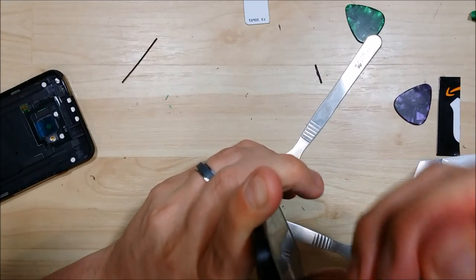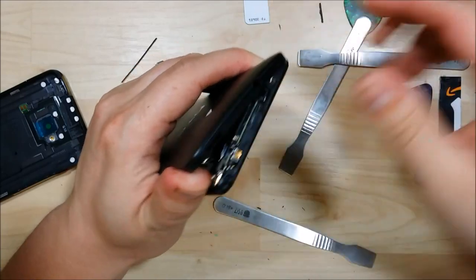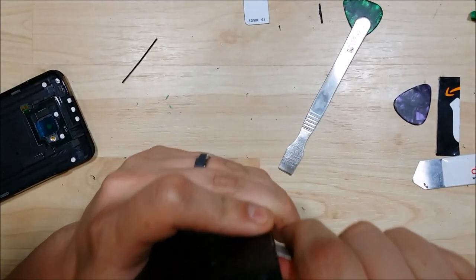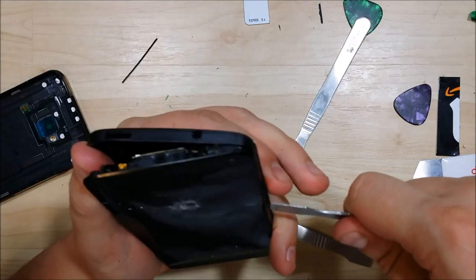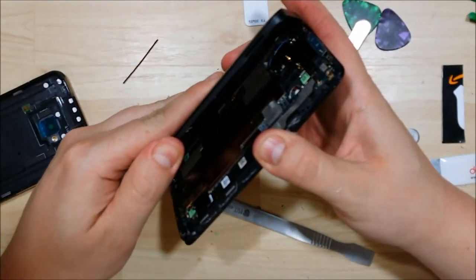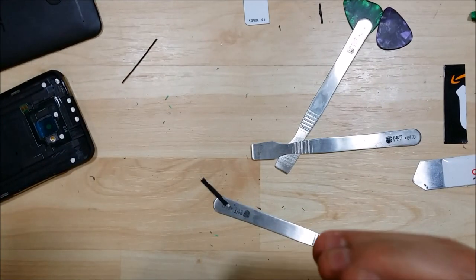I made a lot of progress in moving this housing, but it's taking its sweet time coming off still. Even though one side is unclipped from the actual rear part of the phone, it still just does not want to come apart. I'm inserting my tools to make sure that gap stays there, and being careful around the anodized areas — even though I've already messed up the back housing, I definitely don't want to replace the front housing as well. I've got the front and back and side separated now and can pull it away from the other side. Checking to make sure there are no actual connectors on the back of the phone attached to the back — it had to pull away from the glue on the phone itself.